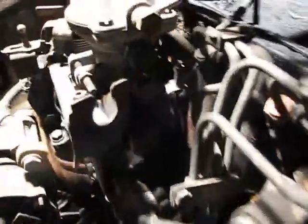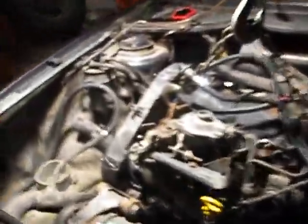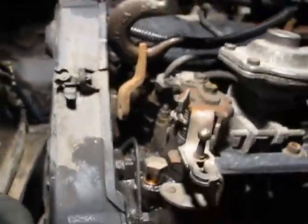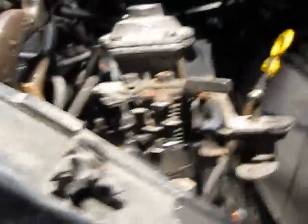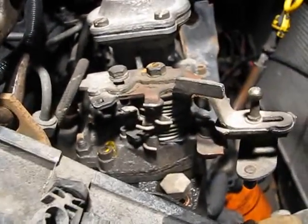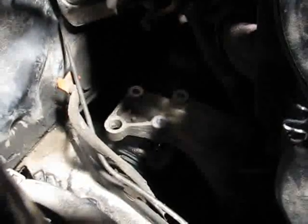So I got four bolts on there to get off and then she'll friggin' pop off. Oh, actually I have to undo all the friggin' throttle linkages and the springs and stuff. Apparently it's not very fun to get the springs back on, so I'll have to be very careful because those things hurt. That's the motor mount I was talking about. It's just those three bolts in a triangle shape - they're 13 mils.